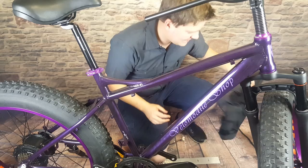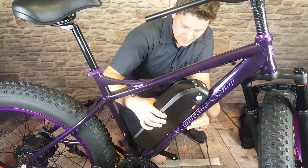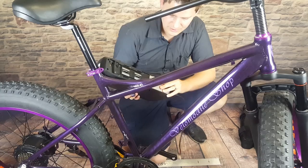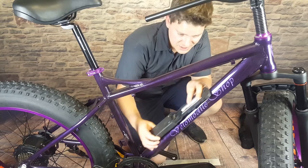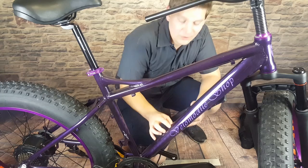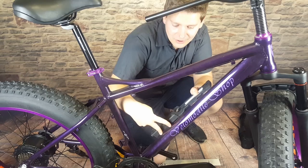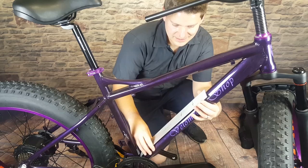What I am going to show you is how to mount the battery to the frame — it's going to sit right about like this. The battery sits on a cradle, which is this piece here, and the cradle needs to be bolted to the frame. They do include holes here, and usually they're slotted so you have some adjustment. One problem you'll run into on a lot of frames is that the holes for the cradle may be here, but since these holes were intended for a water bottle, they're down here. I've made a little aluminum template so all I need to do is stick this on here.